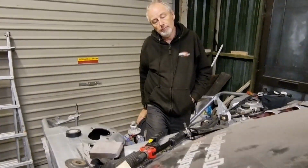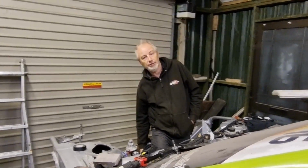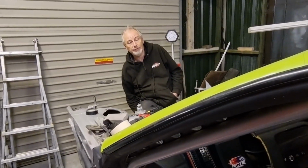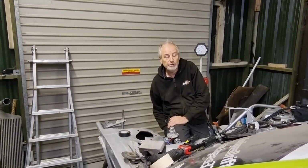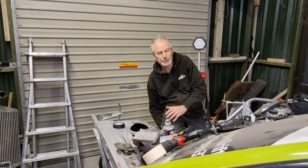So talking about the control box, what was the reasoning behind doing that? I suppose you made one for this car the first time around, with the old ECU setup. Yeah, I was robbing bits of the original relay holders and all that kind of stuff, and that's messy. It was fine once it was done, but this is a much neater arrangement. We can put 10 relays in there, even though I think we're only using 7 at the moment, and 20 fuses. Again, we're not using that many, but there's plenty of scope there if you want to expand. But it's very, very compact.